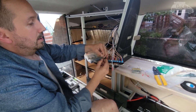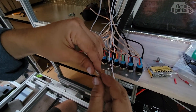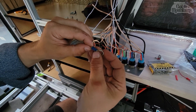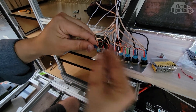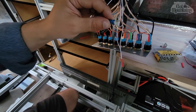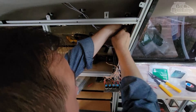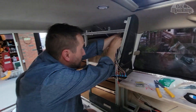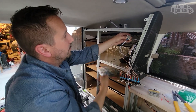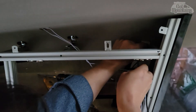I'm going to first twist these all together and then fold them over three times - one, two, three. Then this blue crimp should be enough to bite onto it. It's probably a little too dark for you to see the ground but it's just a riv nut with a large bolt in it. I've already got another ground for the ambient lights on here as well.